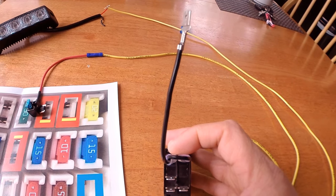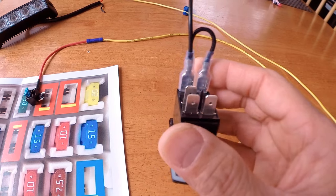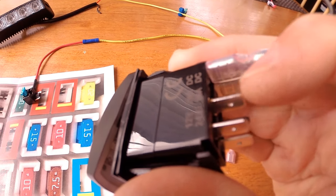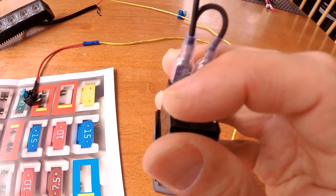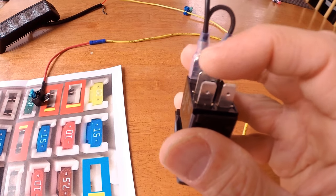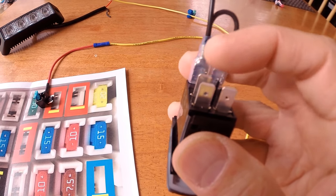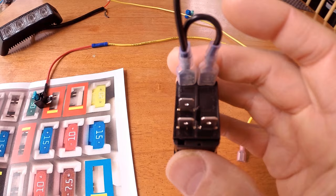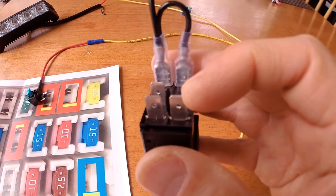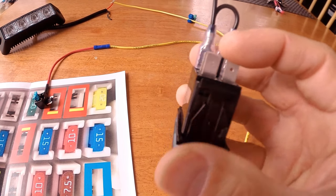And of course, you just need to screw-tap that in onto the chassis of your FJ. And the middle is the 12 volts. Think of it as connected to your battery or the power source. And this one will be going to your accessories or relay. My setup is just 6 amps, and all my wires, including this switch, are rated 20 amps. So I really do not need to attach it to a relay, so I'm just going to wire it directly. This one right here is for the circuit light or your dash light; tap that in using a T-tap. You should be okay.